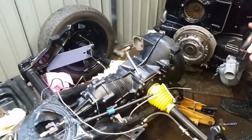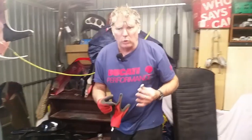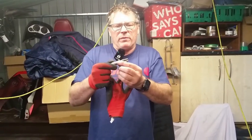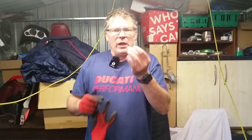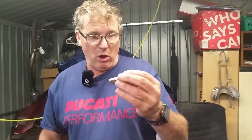These are 18 millimeter holes and bolts, and they're special. They've got a lead in, they've got a shoulder, they've got all sorts. These are US Pro taps, right? And these are 18 by 1.5 pitch. Every Volkswagen Beetle person who does this sort of stuff should buy them. I think they were 10, 15 pounds or something, US Pro eBay.